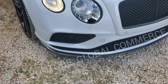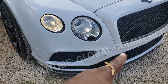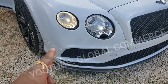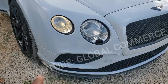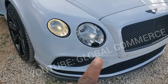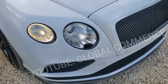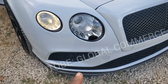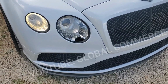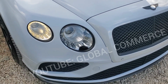Backup camera, it's showing right front. It's either this one or that one. It's showing a short to ground, to positive, which could mean it's a bad connection. And with that being an issue, it'll basically shut off the system for the cameras. So that's what's going on here. So we've got to fix the wiring issue here. I believe this car was involved in a collision in the front, so I'm going to find out. We got to repair that, and that should activate the rear cameras.